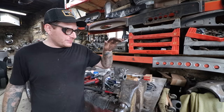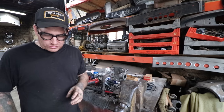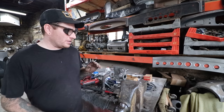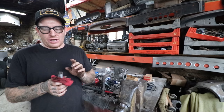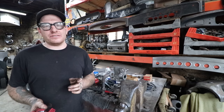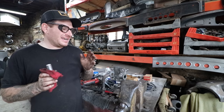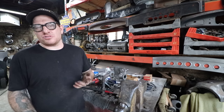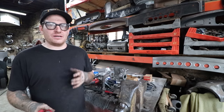All right, so we're knocking the kingpin bushings out of these spindles for the 34, and I wanted to stop and just give a couple options for this. Some people like to use a press to knock these out, which can be handy if you have the exact right size piece that you can machine and press it out. It does work well, but sometimes I like to show the down and dirty ways that you can do this. And sometimes, honestly, if the bushings cooperate, it's actually quicker this way, and I sometimes choose this over trying to get my press and get it all set up with just the right blocks, everything sits perfectly straight.